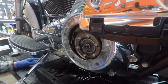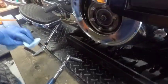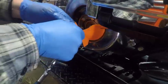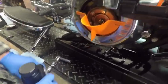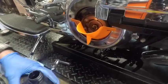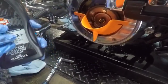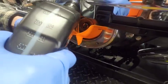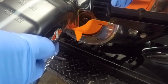You don't want to overfill this. Yeah, I would stick to a liter, nothing more. My special Harley-Davidson bottle here - it helps. Yeah, that would be really hard to put the oil in without that, wouldn't it? Yeah, you could do a lot of spillage. Formula Plus transmission and primary oil, and it'll take pretty well a full liter. That'll bring it up to the edge of the clutch hub.